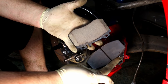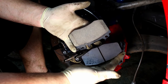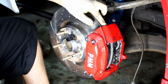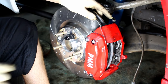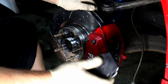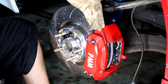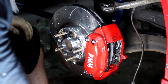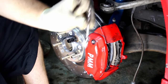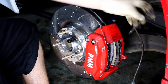Here's a comparison of the pads — here's factory and here's the Mercedes. A lot more surface area on the Mercedes pad. For some reason this caliper needed three washers on each bolt instead of two. The other side only needed two to be centered, but with two washers on each bolt, this pad would not fit in here — the rotor was too close — so I had to put a third washer on to push it more to the side. Now it's centered and I can get both pads in. These brake clips can only go in one way — this side is fatter, this is the skinnier side; skinny holes on this side, fat side in the back.